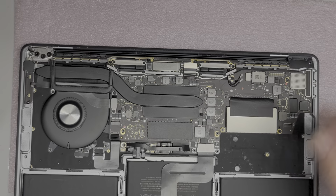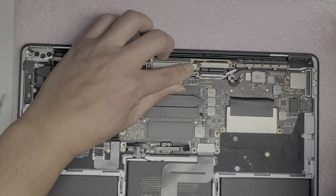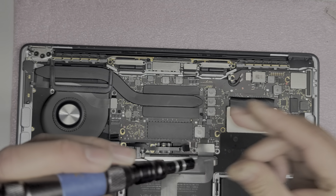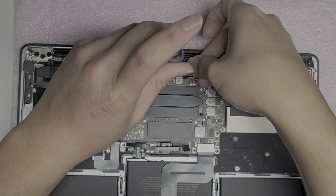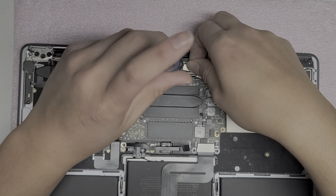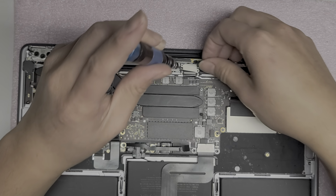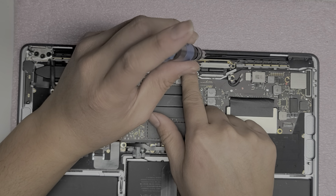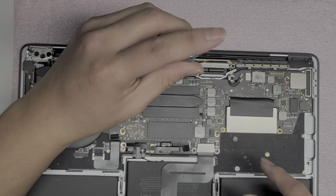Now we're gonna switch back to the T4. We're gonna connect this thing back in place. All right, so reconnected the screen. Get the bracket. The thing I find that helps is you can get the screw, take the bracket, put the screw in the bracket, and then you can use the bracket to help you guide it into place. Sometimes it helps to hold the bracket up while you try and put the screw in. There we go. Okay, grab the other screw, line up the bracket, and then tighten in. And then retighten and then completely tighten down that one.